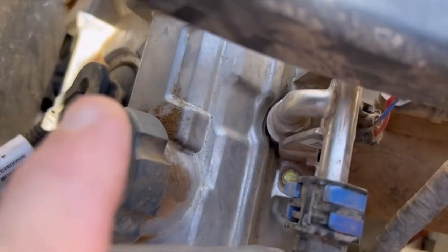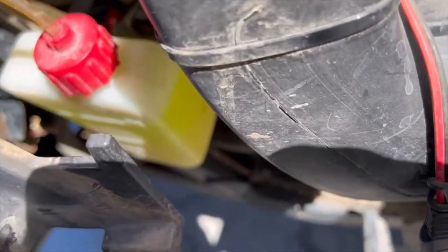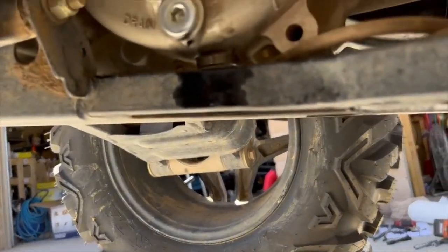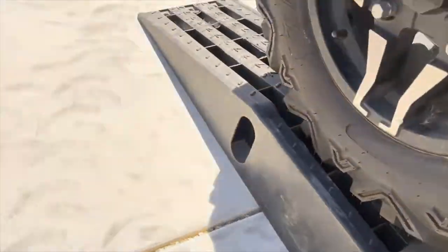Just to recap everything: spark plug is up here, air filter is right here with that extra shroud over it for the desert. We added coolant here — this is your overflow and the actual radiator cap is in there. On the other side: oil fill here, oil filter down there, drain plug is underneath. The drain plug for your rear transmission and rear differential is right here; the fill plug is on the other side on the left side. Your fill plug for the front differential is right here — very hard to get to.